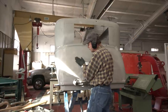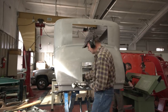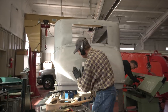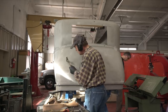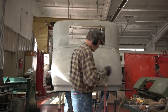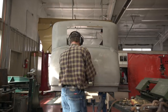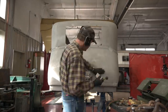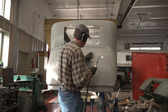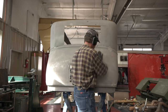It sure is nice to have a lot of tools in your toolbox, and one of my favorites is this portable planishing hammer — it is wonderful. The only downside is if you overwork it you've stretched it too much and now you've got to come back and shrink it. So I'm doing a little off-dolly work here — the dolly is right next to the hammer, kind of shrinking it that way. I need a little bit more, so instead of going to the shrinking disc I use the torch on it and just get the metal warm so it's coming up at me. I don't want to see any blue spots or red spots — just enough to move that metal up and then shrink it down with some off-dolly hammer and dolly work, and it worked out real well in this case.